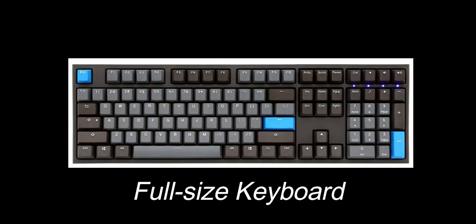It's also a 40% form factor, which means it's really small. Mechanical keyboards come in many different sizes and they remove more keys the smaller they get. The full-size keyboard with a number pad is 100%. This one's a 65%, which means no number pad, there are nav keys and arrow keys but no function row. The Planck is a 40%, meaning no number row, no function row, no number pad, no nav keys — it's just this.